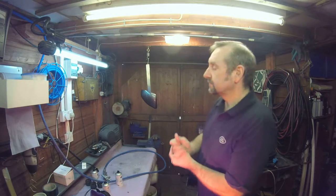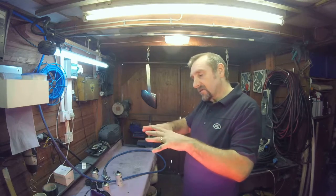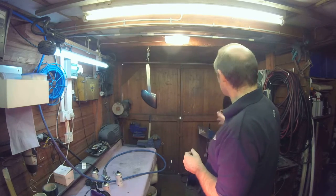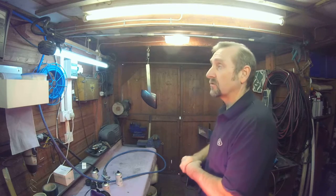The other reason, as that paint is drying now, it's still flowing out nice. If you were to heat set it, it wouldn't flow out quite as nice. Let it do its thing naturally. It's quite warm in here. I did do the temperature earlier, it was about 22 degrees and that's centigrade, so it's quite warm in here to paint.